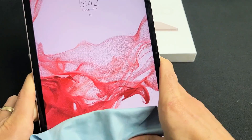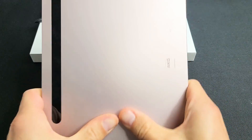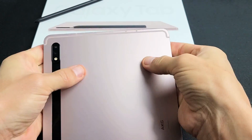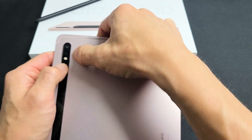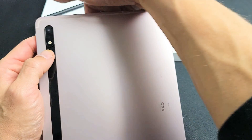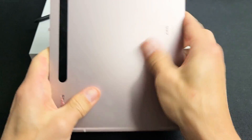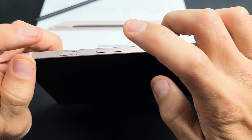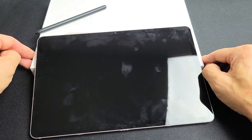Just keep massaging — press all over. Same thing on the back: press, press all over, even around the camera lens. Turn it over, and if you're still stuck in a boot loop, no problem — same thing from here. We're going to force restart it. Power button, volume down. Press and hold both buttons and do not let go until we see the Samsung logo appear, then let go. If you're still stuck, we're going to go to the next possible solution.